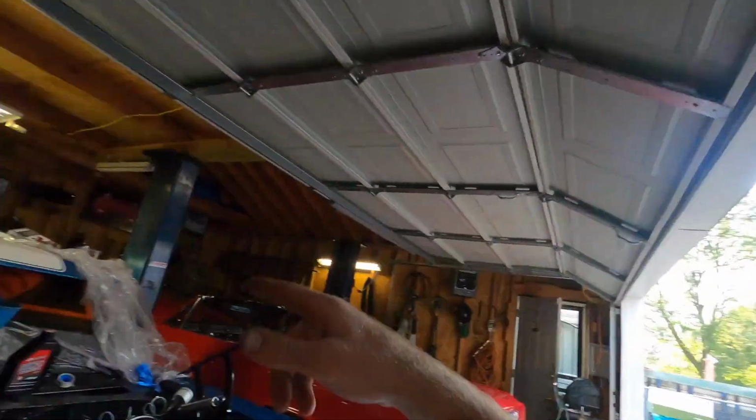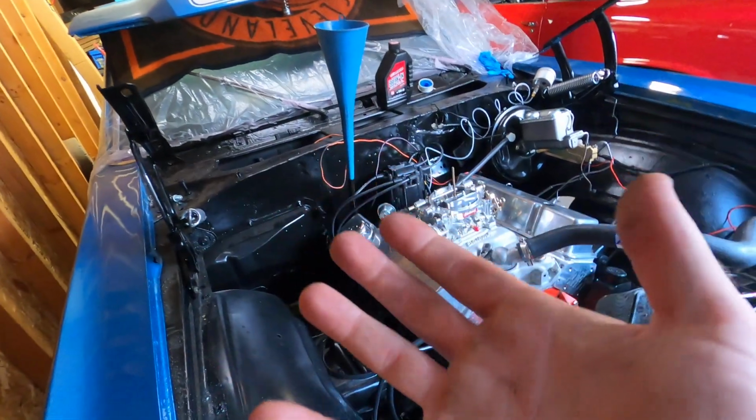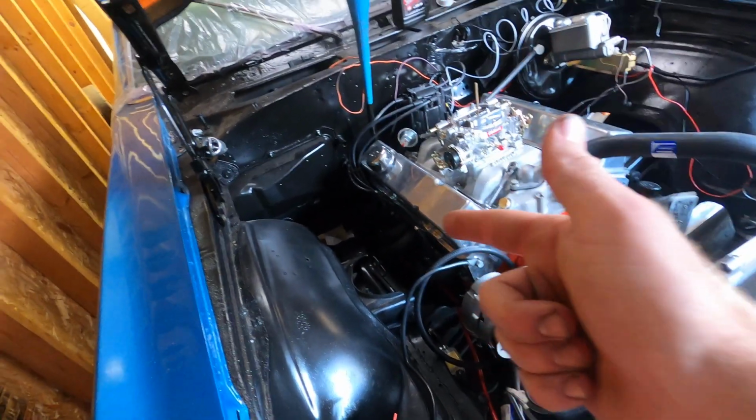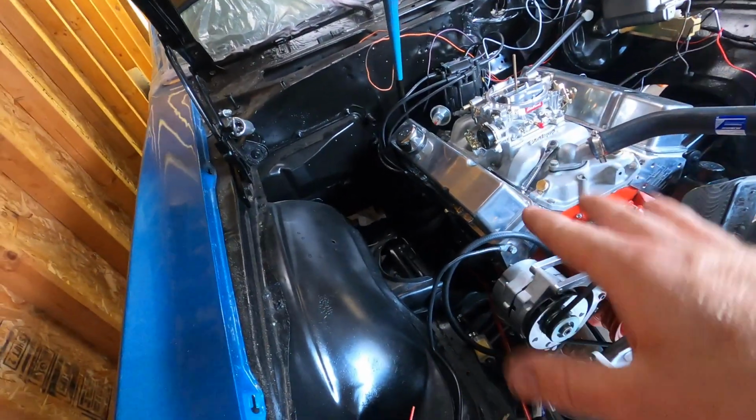So, on Turbo Hydromatic 350s, there is a kick down cable. It's like a whole cable, and it goes into this little valve with this little clip, like spring tool or whatever it clips into. So I started pouring tranny fluid in this thing, and it started coming out of that hole because there's no cable in there. So luckily, Tony had a cable that was never going to be used anyway, so I cut it so it's just in there to plug the hole.